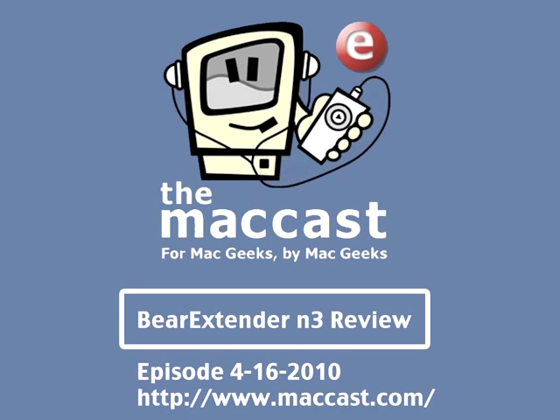It's a nice little product. One thing to note about the 802.11n: it does support 802.11n, but it needs to be running at the 2.4GHz band. So if you're running a 5GHz-only N network, it's not going to work for you — you'll have to enable the 2.4GHz band. That works out fine for me because I use iPhones in my house, including my iPhone 3GS, which needs to run on a G network. I also have the newer dual-band Airport Extreme, so I can have both a 5GHz and a 2.4GHz network running simultaneously, and a lot of newer third-party routers support that as well.